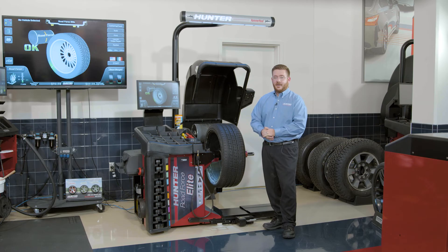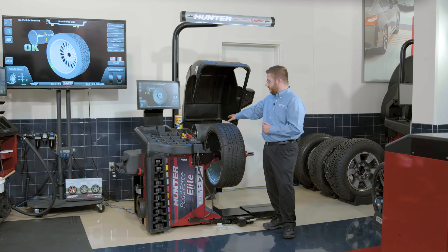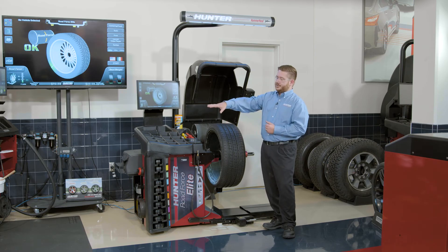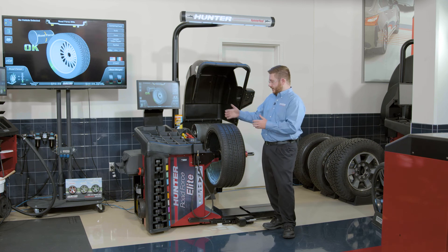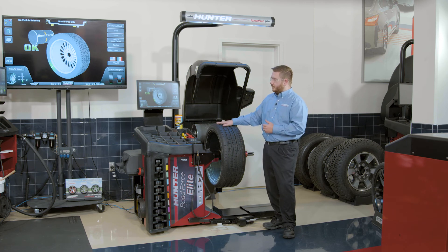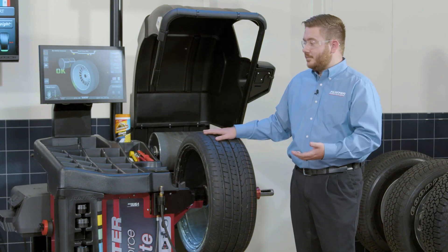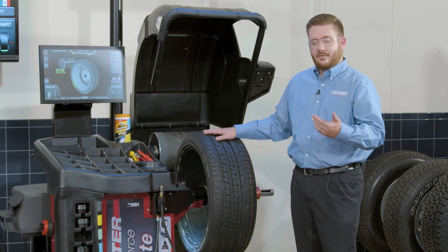So that's the force match procedure. To recap: we took our tire and wheel assembly off the vehicle, placed it on the balancer, measured road force with the load roller, identified where our stiff spots were and marked those on the tire and on the rim, took the assembly over to the tire changer and clocked those two positions together, brought it back to the balancer, and remeasured our road force — reducing our road force value by almost half with that simple process. We were also able to balance the tire after that process to guarantee a much gentler riding assembly for the customer. Very simple, very easy to use. Thanks for watching.